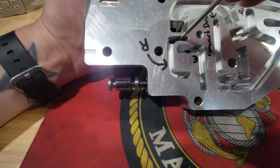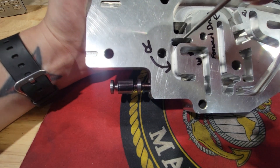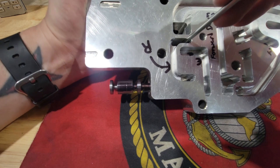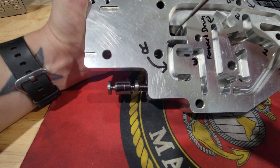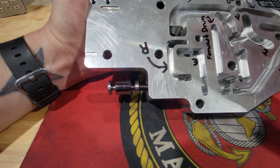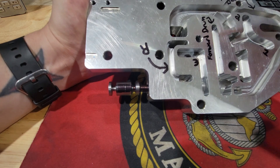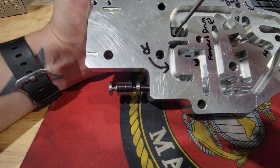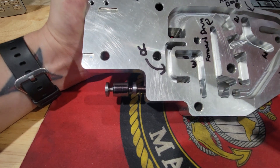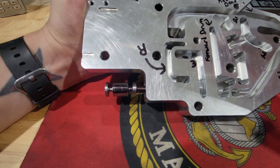This being an internal trans brake, the fluid is sitting in this cavity under pressure but it's being stopped by the trans brake solenoid. In reverse with these valve bodies, you need to activate the solenoid to allow the vehicle to go in reverse, even though the manual valve is selected to reverse.